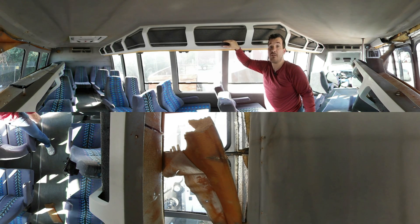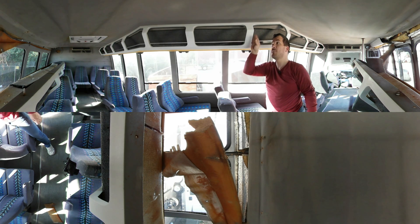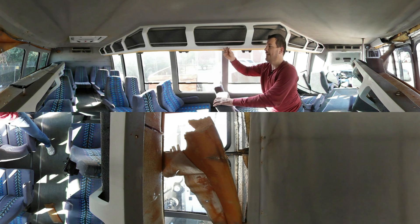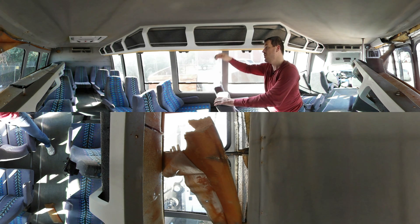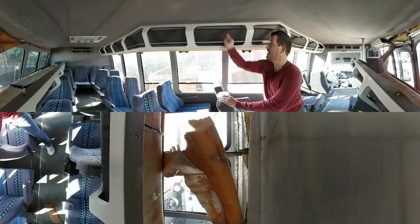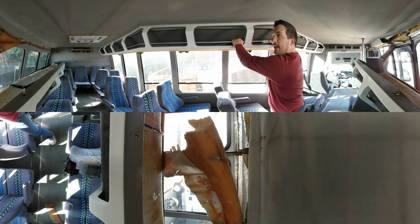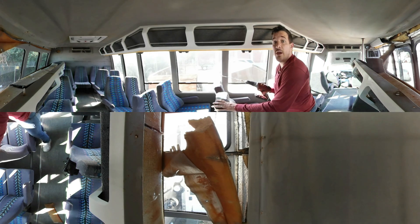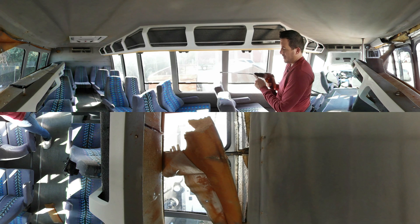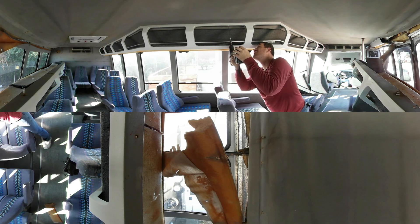Now that I've got that trim piece down, there are some bolts right behind here on this lip that screw into the overhead ribs of the bus. They're just self-tapping metal screws that screw into the ribs and there's a big washer. Once I remove all of those — there's some right up here and some in the back — I'll be able to take down this whole overhead bin. I'm going to be using a drill adapter for a quarter inch socket extension with a wobble on the end so I can get all of these off pretty quickly.